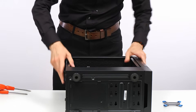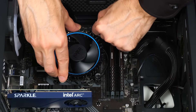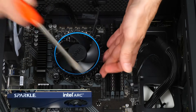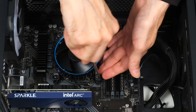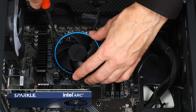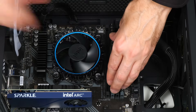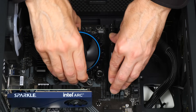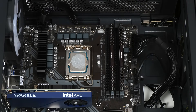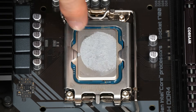We'll put the PC down on the desk. The first thing to do is unplug the CPU fan from the CPU fan header. We now need to release the push pins that hold the cooler in place — take a screwdriver and these should just pop up. All four pins are now released and the old cooler has come off. Anything left to do is to clear up the old thermal compound left on top of the CPU.